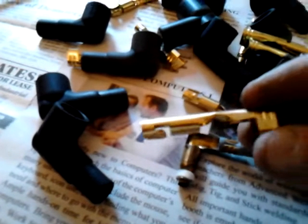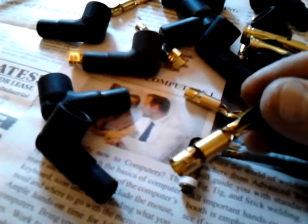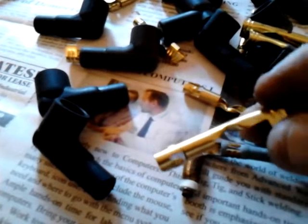...boots so I can get the connectors out. These are special to Land Rovers — has a nice seal in here. This is the new connector; it's the socket style like on the old V8s, and most older generation engines had these.